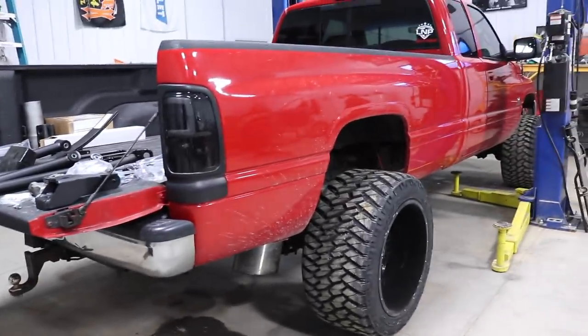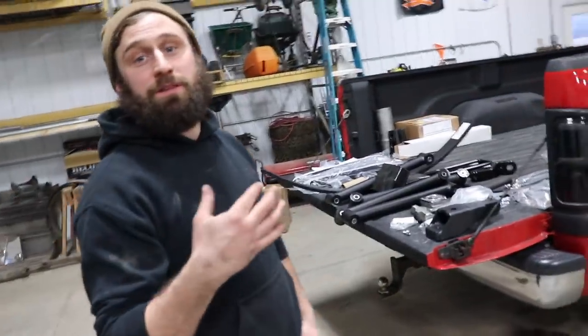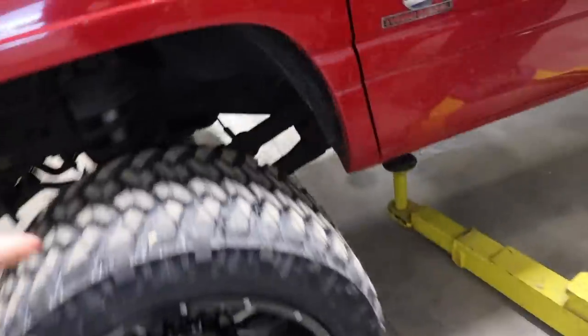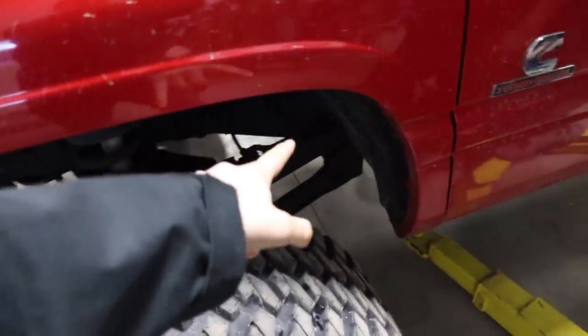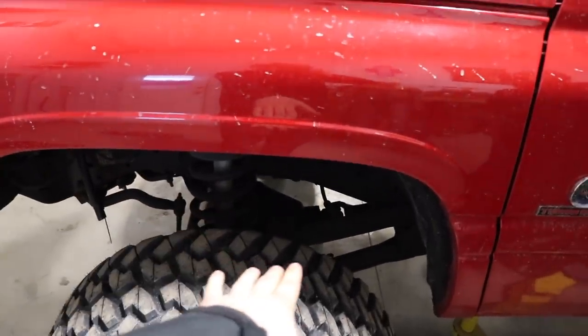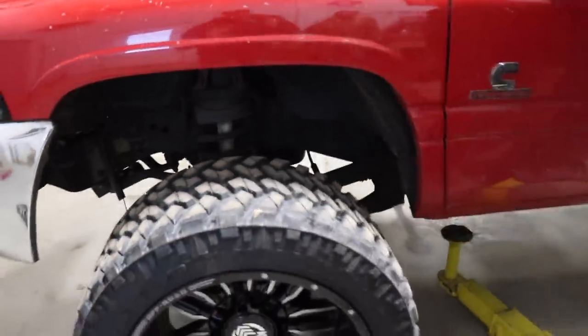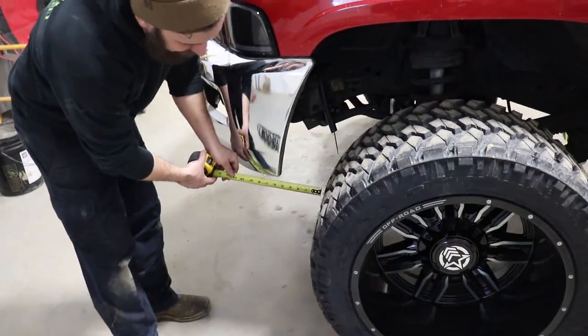For this truck, all we've got to do is get the front upper and lower control arms to extend them, and other than that it's already good to go. Here, we'll show them — you can see the gap. These upper and lower control arms are a nasty red. What they'll do for this truck is they're two inches longer and they push the front axle a little bit further forward. When you lift the front end up, it basically hugs that axle further back toward the fender, but when it pushes it back out, it's got like a three-and-a-half-inch gap there versus four-and-a-half or five on the other side.